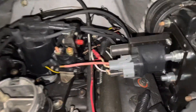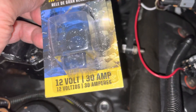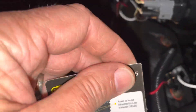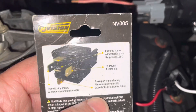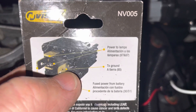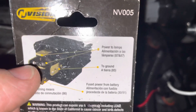So what I've done is I bought a relay and the box. This is a 12 volt automotive 30 amp relay I bought at O'Reilly's. If you're not familiar with relays, what they do is use a small amount of current — a smaller power source — to switch a bigger power source. It's like a light switch, but instead of your finger switching it on, it's a small electric current. If you look at the back of this diagram, that terminal by my thumb says terminal 85 to ground, and terminal 86 is what's used to switch this relay on.